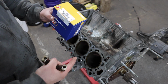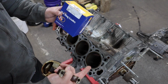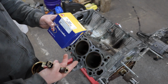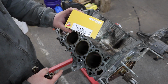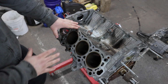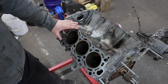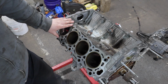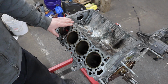Now, I just think the part number for the box of 8 is discontinued. They're still making them because this is basically the same piston ring. It's just a set of 6 and not 8. So this is what you'll have to get if you plan on changing the piston rings in your late model 1UZ. Now that we know about that, we're going to check the ring gap for the piston rings. Certainly you want to do that because, even though I trust these piston rings that I got because they're for a different engine, we're certainly going to check the ring gap.